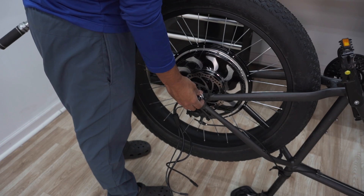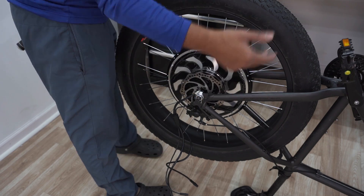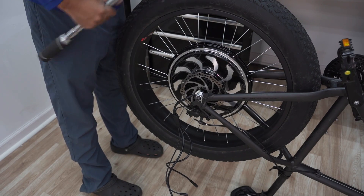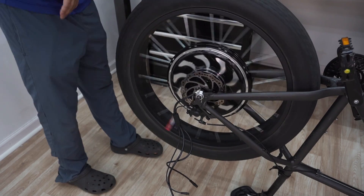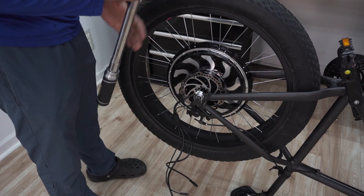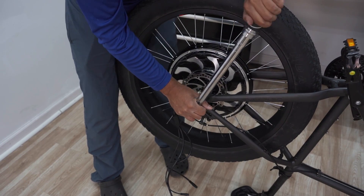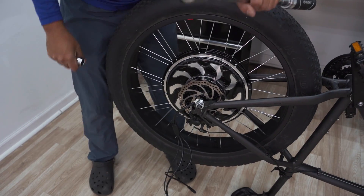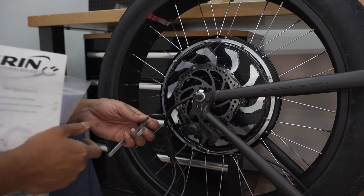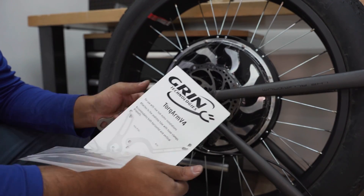I got the spacings figured out. On this side I didn't put any straight washer because the freewheel was actually hitting the chainstay, so I put two straight washers on the other side and none on this one — and it's rotating pretty freely. I got the tab washer on. Now you want to tighten this very, very well. On the other side I already tightened the bolt all the way — make sure you tighten it all the way, otherwise you can have problems.